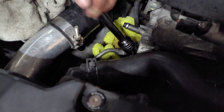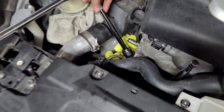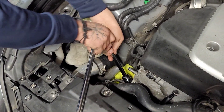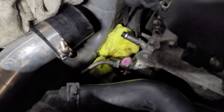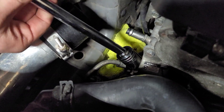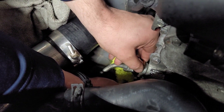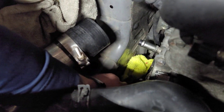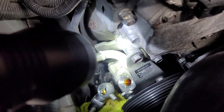We're still going to leave the pump bolted on so we can put torque on it. The banjo bolt is a 24 millimeter, so we have a big breaker bar. He's taking off the high pressure line right now, and your new power steering pump will come with new copper washers. We dropped the old ones but it doesn't matter — we have new ones anyway.